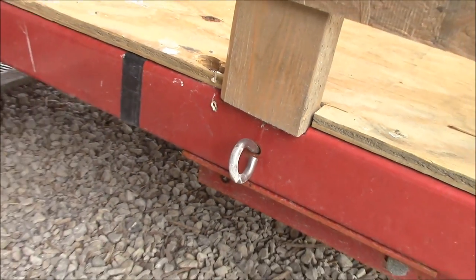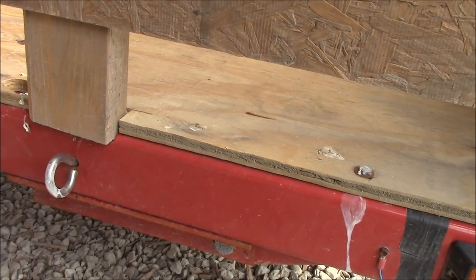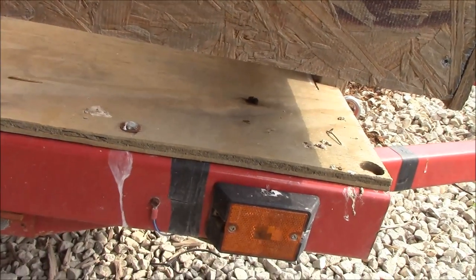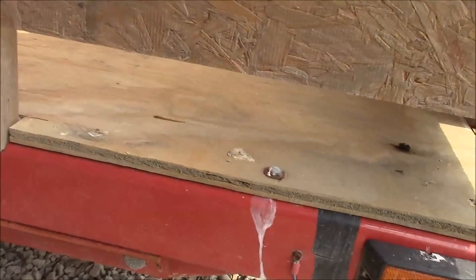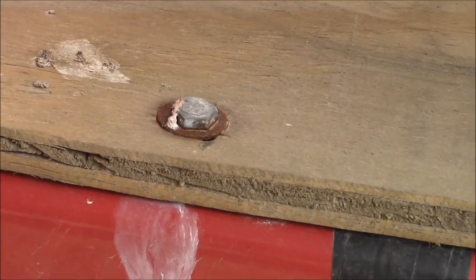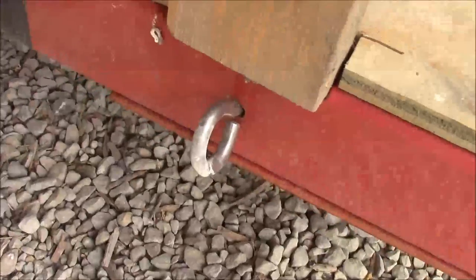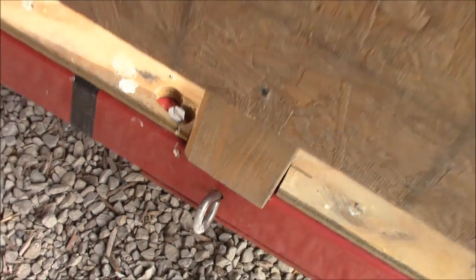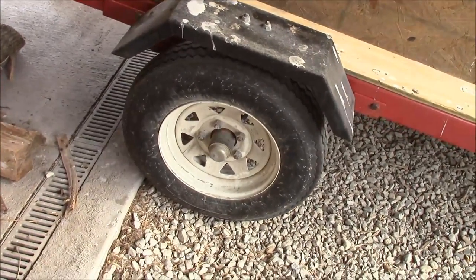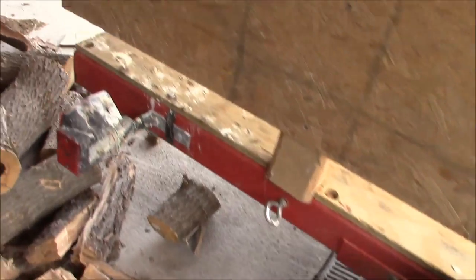The trailer recommends a three-quarter inch plywood treated deck, but I put a half-inch deck on it, supported by about eight screws. I also put stainless steel eyelets in to hold the wood stakes, which are just two-by-fours. The walls are untreated OSB. It has a 12-inch five-lug wheel, which is always a plus.